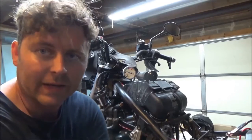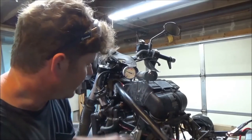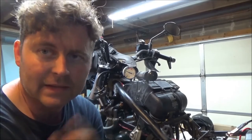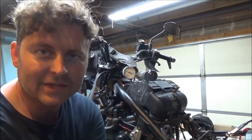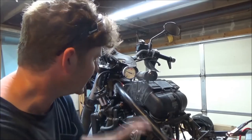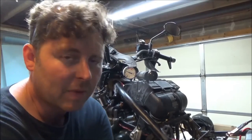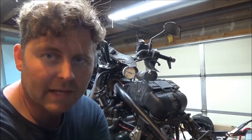I'm super happy right now because this bike had less than 20 ounces of coolant in it when I drained it. It was literally out of coolant and the thermostat was stuck shut — a big clue. We had two sources of leaks preventing it from building pressure, which means the boiling point of the fluid would be much lower. This is a 2002 motorcycle — you want to bet that coolant was old and never serviced? It's a highly overlooked item, and on this Tiger you have to remove the entire tank, fairings, and body just to get to the cap. Probably extremely overdue on the cooling system.